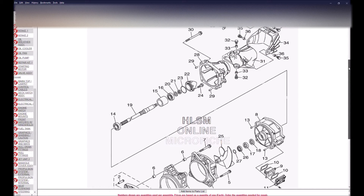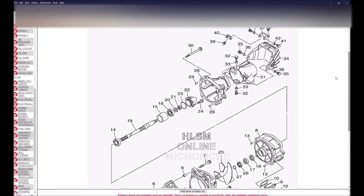Up at the top, you have the cone. You have the nozzle — I call that the reduction nozzle because it is reducing the diameter of the water coming off of the pump, compressing it down into the exit. They call it the deflector, but I call it the steering nozzle. And then there's the reverse gate.